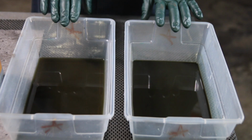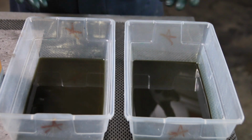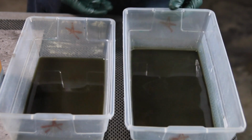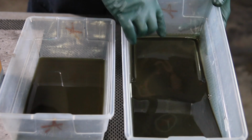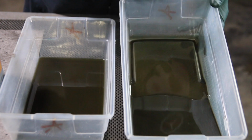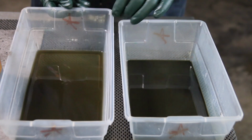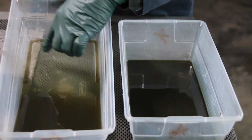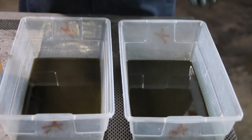And you're going to understand why I'm a firm believer in this dual flush method when working with a transfer case, because it doesn't hold very much fluid. So look at the original fluid. When I tip this container up, look at how dirty that is. Now here is from the first flush. It appears to be a little dirty, but look at how much cleaner it is, looking right through to the plastic. So you can see how important that is.